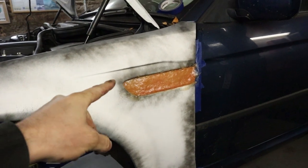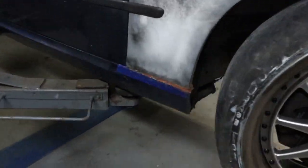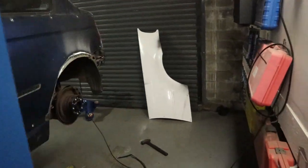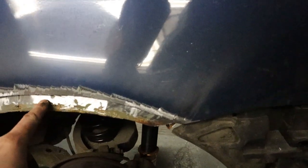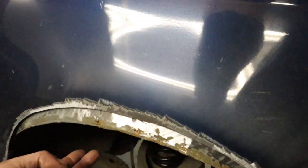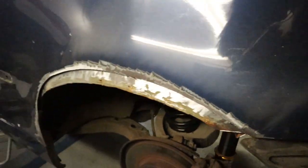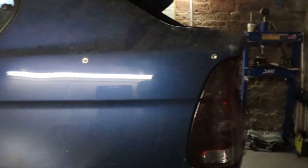This has been in the shed for a while now and it's getting late. I put the fiberglass on - fiberglass is here, filled in a good bit there and down there, same on this side. I've got all the rivnuts in. I've cut out part of the arch here and taken the grinder to it so it's ready for welding. I'll pull that and push that, weld the two together with loads of little welds. Then I'll cut along here, cut all that off, put everything back on - wide body done.